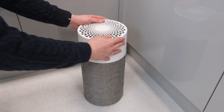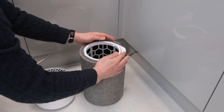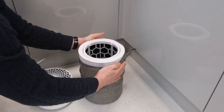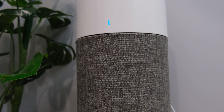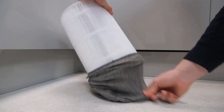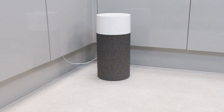Of course, while those features are important, the heart of the 3210 is its filter cartridge. This is accessed by pressing down on the top portion of the unit while twisting anti-clockwise. The fabric pre-filter can then be opened up to reveal the filter inside. This model, like most, uses a three-stage process to remove pollutants. The first is handled by the pre-filter, which blocks large particles and debris, preventing them from reaching and clogging the finer filtration levels. This pre-filter is machine washable and can be removed and replaced if desired for different colour variants.